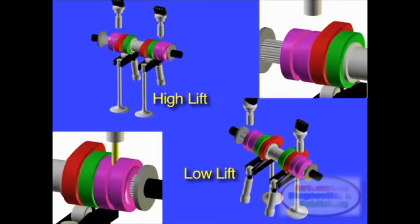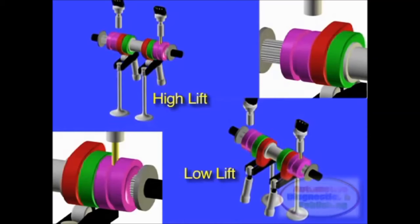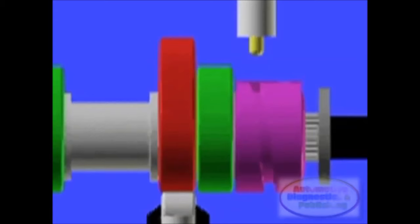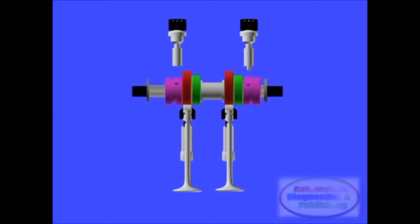A spring-loaded latch will lock the cam piece in the new position. In this way, the operating cams are changed from one set to another. To change to another cam, the metal pin presses against a reverse spiral groove, and moves the cam lobe piece back to the original position. The cam piece is locked by the spring-loaded latch again.